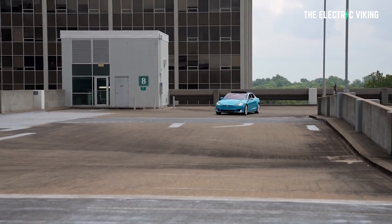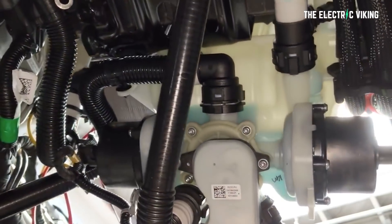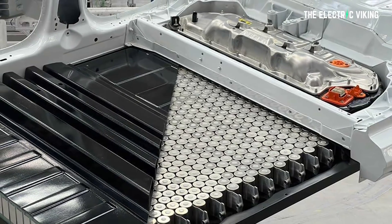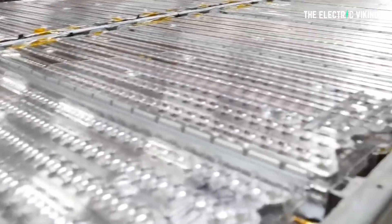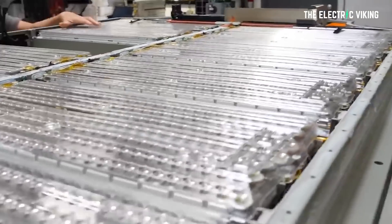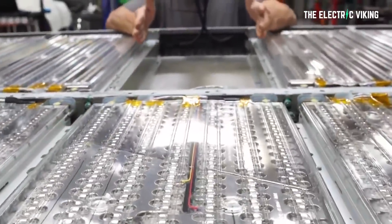When the P100D came out, Tesla broke the one cooling tube into two tubes, essentially adding more cooling. The company also slightly increased the cell count in the pack, but the number of cells cooled by one tube pass was decreased by a factor of almost two — from 444 down to 258. That's a pretty big difference. But it still really wasn't enough. Now in the Plaid, there's another reduction by roughly a factor of two again, down to 144 cells per tube.